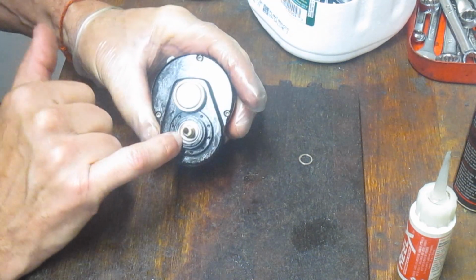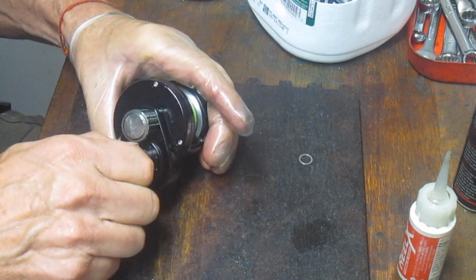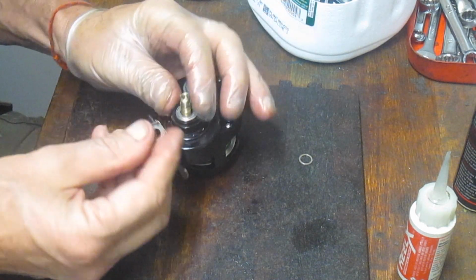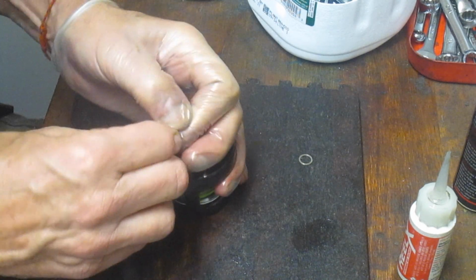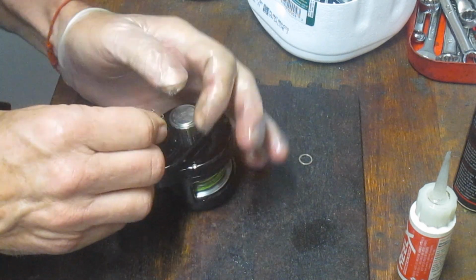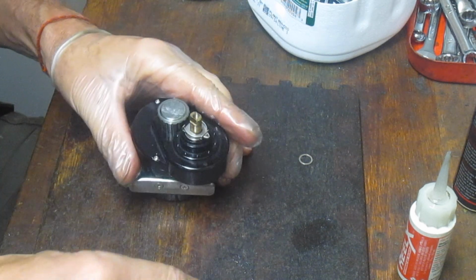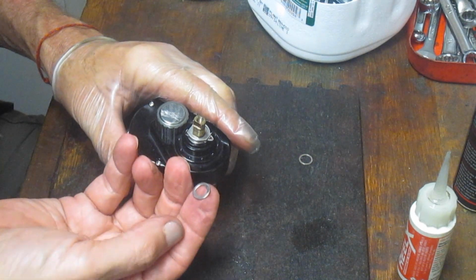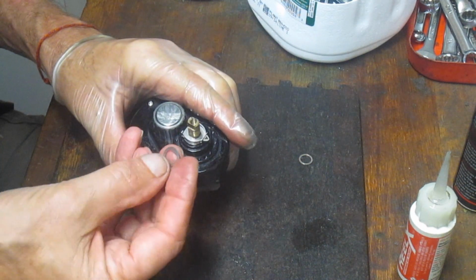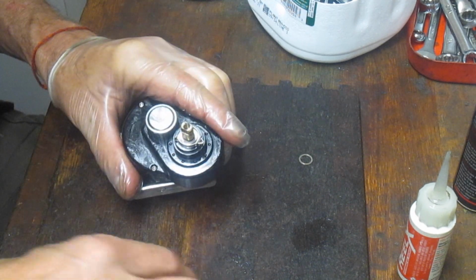I guess I put the bearing shield washer on already when it died, so I would just hope that it's there. Next up then is the little click ratchet. This was hard coming out, so I guess it's going to, there you go, hard going on. And we had the 4 of the tension washers. They were all nested. You have a shiny side and a dull side, so I'm going to put dull side up just to keep the piece consistent.